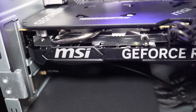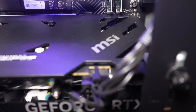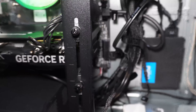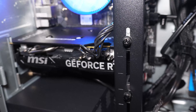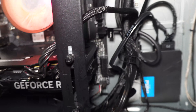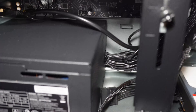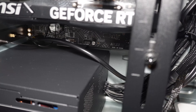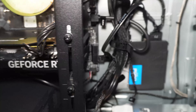The graphics card in here is a 4060 Ventus 2X Black 8G overclocked. It's quite a small card. They've also got a bracket in here which is holding it in — I'm not quite sure why you need such a strong bracket for such a small card, but it's quite useful. It's there because obviously if you did upgrade your card, you could have something bigger in there. However, upgrading your card with a 500-watt power supply might be challenging considering it doesn't have high power output.